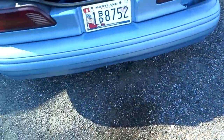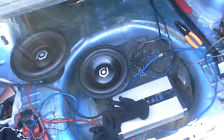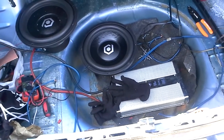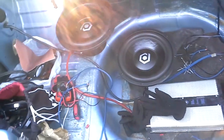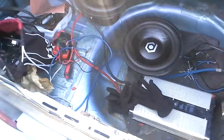The funniest thing happened to me 2 days ago. The day I got my box and everything, I plugged everything up. The same wiring configuration, the dual 2 at 1 ohm and the dual 4 at 2 ohms, and of course the amp, like I said before, seeing like a 0.7, 0.8 ohm load. And I had it hooked up even before I had the ported box inside here, and the amp didn't go into protect unless I had it up at 40, and I figured that out, so I wouldn't play it no more than like volume 34, so it wouldn't overheat and go to protect.